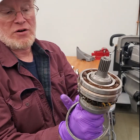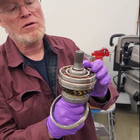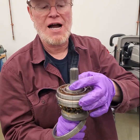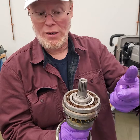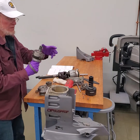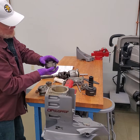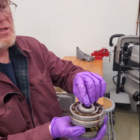It's not very wide and it's very important that you bolt the retainer down in the case. I'm going to slowly remove and drop that shaft down — what you will see is two what are known as retainer keepers, and those just fit in the groove of the shaft. I need to take those off. At that point I can flip it back over and take the gear off. I'm going to turn it back over and pull the vertical drive shaft out.